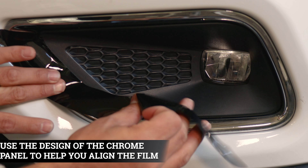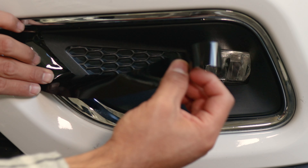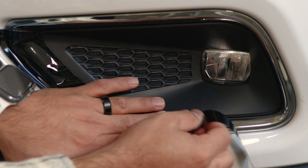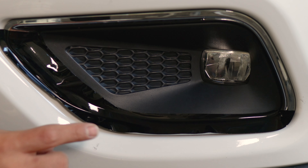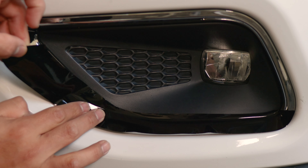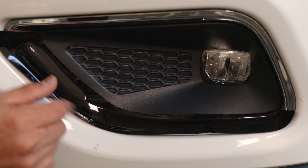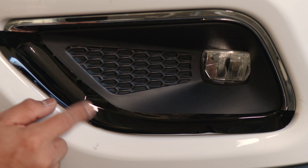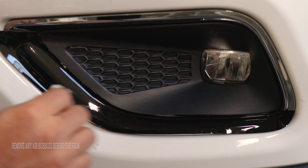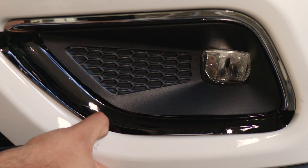Now that we have it aligned, lift the film carefully and finish aligning it to the rest of the panel. You can hold it with one hand and help it tack down and guide it to the rest of the panel. If you do use that method, you're going to encounter a finger. To remove it, just lift this section and place it back down — pretty easy fix. Just make sure not to lift it too hard so you don't accidentally tear the film. Now grab your squeegee and start securing the entire panel, making sure to remove all the air that may be underneath the film.